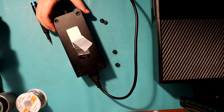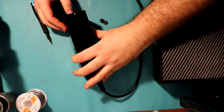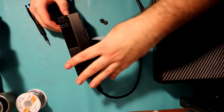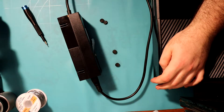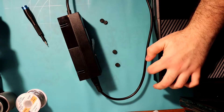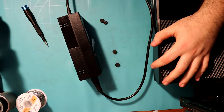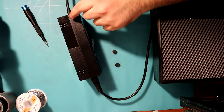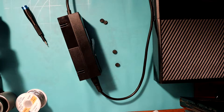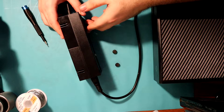Before we continue — I actually haven't pulled the plug yet. So what I'm gonna do is pull the plug and then power the Xbox on. Now that I've done that, the capacitors should be pretty much dead in here. That's a good thing because you don't want to get shocked by your power supply.